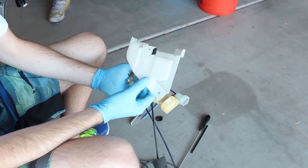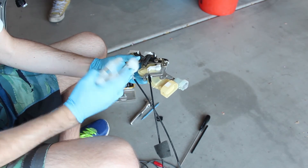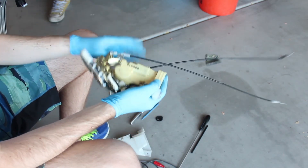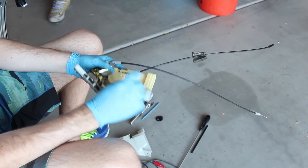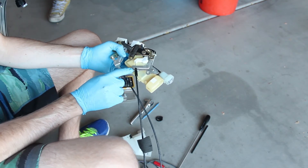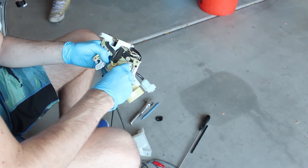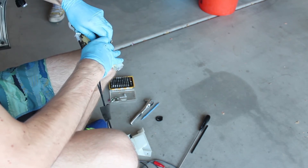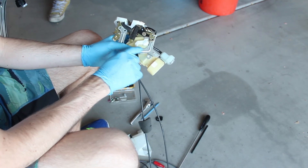At this point, all I've done is take off this plastic cover from the actuator assembly — basically all you need to do is take out one little screw right there and the cover just slides off the back. If you flip this over, you'll see there are two screws, one here and one here, that you're going to need to take out. But before you do that, you're going to want to take this cable out from its little slot and disconnect it. I'll pop the cable out of the slot and come back to show you how to take it out of the rest of the mechanism.